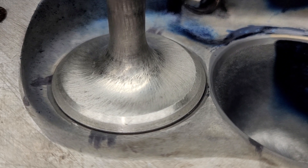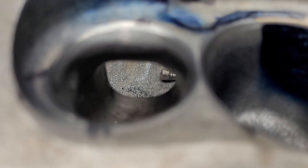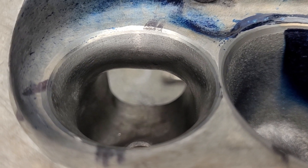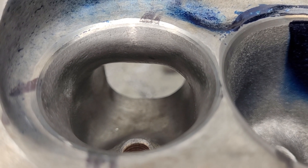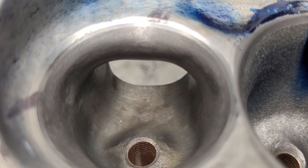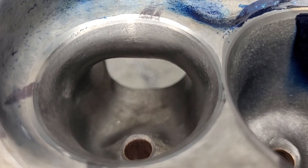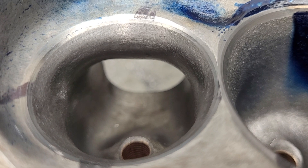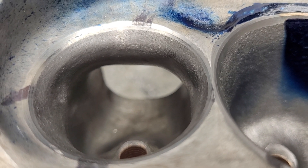The exhaust used the exact same valve as last time. The only thing I did on the exhaust is the valve job, which is a touch better than it was, and I radiused out the throat. The rest of the port has not been touched — it's still got the old dirt and stuff on it. I wanted to see if that radius throat makes any difference on this exhaust port, whether it boosts our efficiency or not.